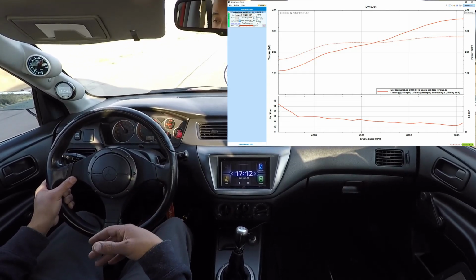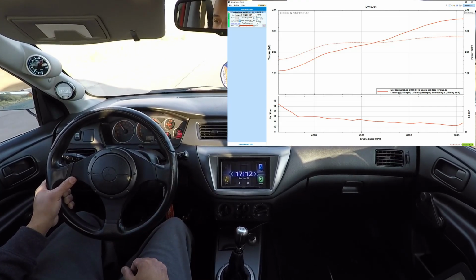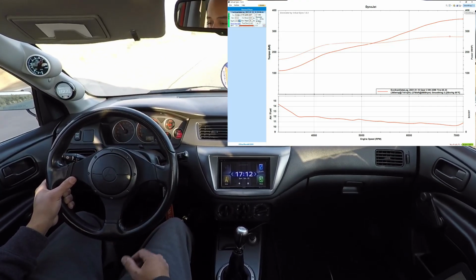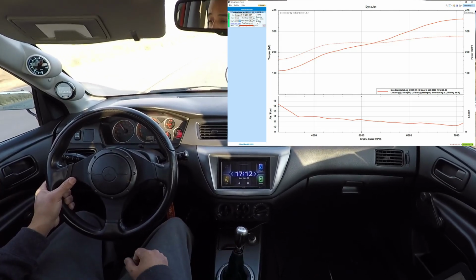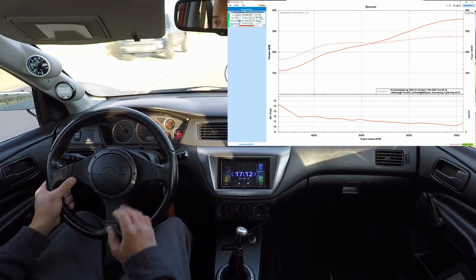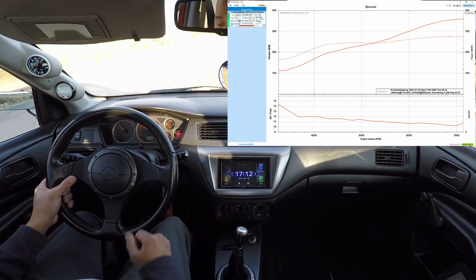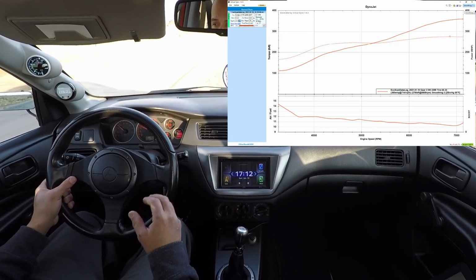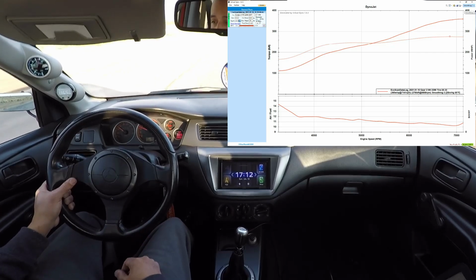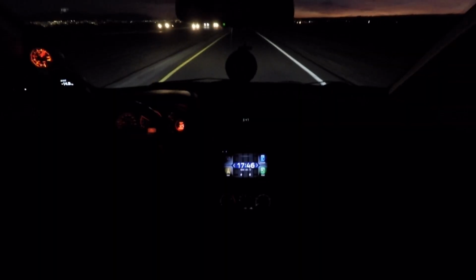I definitely do want to see actual numbers. The issue here with ethanol is knock. Usually knock is a deterrent and a point where we stop increasing timing and boost. But with ethanol, because it's such a good knock deterrent, we won't know. And we will definitely cross the power that the stock internals can handle. That's why you always want to tune E85 on a dyno.